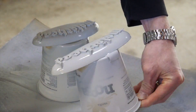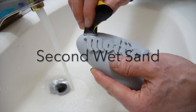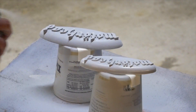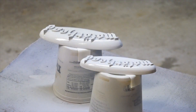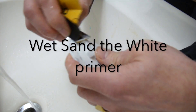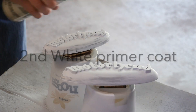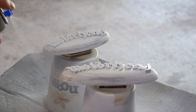I wet sand, put another coat of primer on, then wet sand that down — I'm trying to achieve a really nice finish. On top of that I'm adding a coat of white primer and sanding that down as a base coat. Remember: always use a sanding block as a safety precaution, and make sure you're always wearing a mask when you're spraying paint. Here's a second coat of primer.